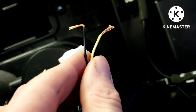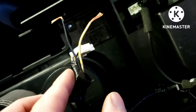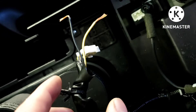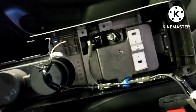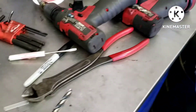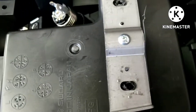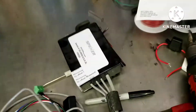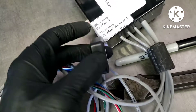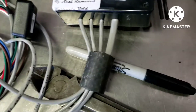I needed both hands so I couldn't get it on video, but the 12-volt outlet plug is key-on power — it turns on in accessory and key-on. As long as it's got power while the car is running and not when it's off, you're good. I'm going to plug it in there and get the center console out to modify it for mounting. I'm drilling a big hole for the wires and using Velcro command strips to mount the module inside. I widened the hole a bit because the G-sensor needed to fit through, and I put some heater hose around the wires for anti-chafing.